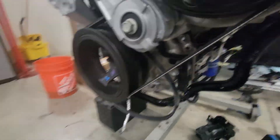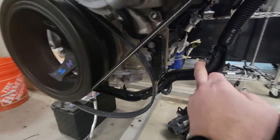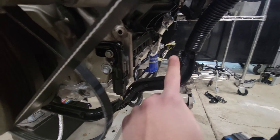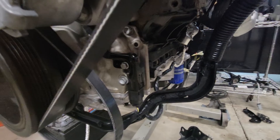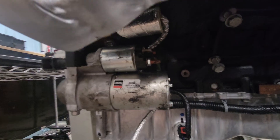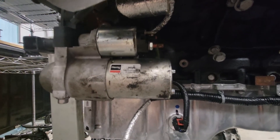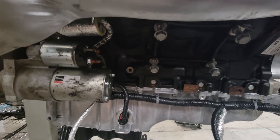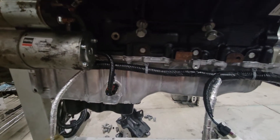The harness snaps into place down in here just fine. Without the vacuum pump, that mount isn't needed — there's just a little friction clamp there for the side of the pump, but everything else mounted up fine. I'm going to throw the flywheel on and crank it over with a battery, pull the plugs, and get it nice and primed to make sure all the oiling is right. I had the oil pan off and want to confirm everything's good.